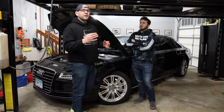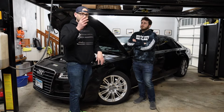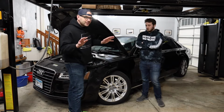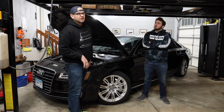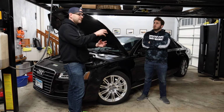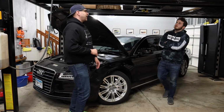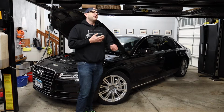I was fearful of actually disconnecting the air strut, meaning the air line and the sensor connector, only because I wasn't familiar. I was scared that if I disconnected that stuff, when I plugged it back in, something wouldn't work right, I'd have an alarm. I don't think that's the case, but that's where I was in my mind. So I disconnected all the connection points on the suspension, top to bottom, so that air strut was still in place, connected with its airline, but I could maneuver it just enough to get that top bolt out of both the upper control arms. After all that, I was able to change those upper control arms, but here's what we found.